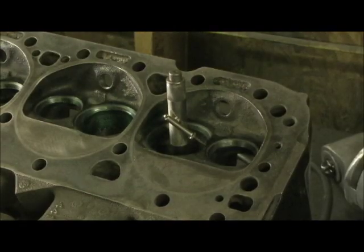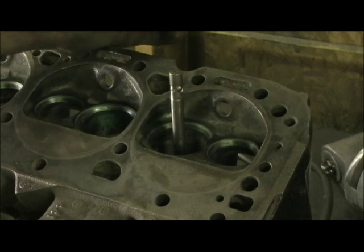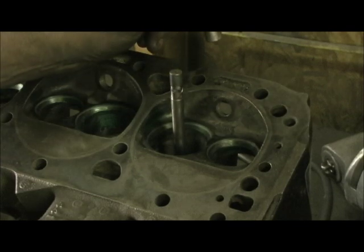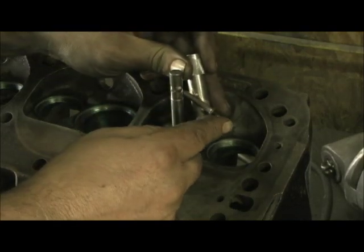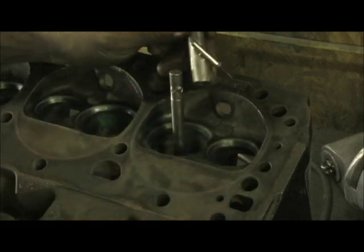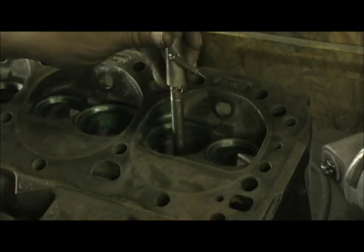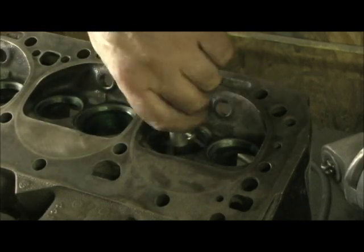In this exercise, I did the math and came up with 92% of the valve diameter, and I set this scribe. It's got a locking nut and a position here — I have a length measurement that tells me what the imprint's going to be. I then put this on there and scribe the line.